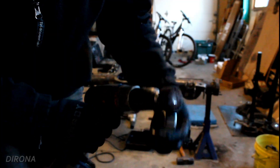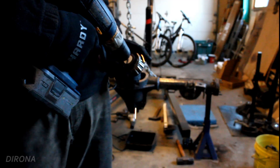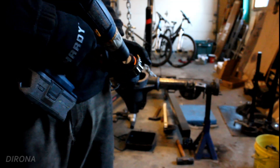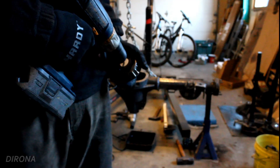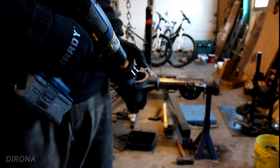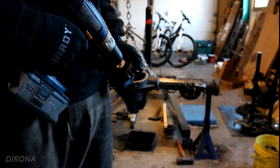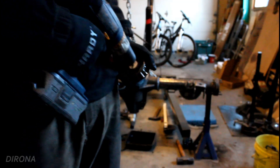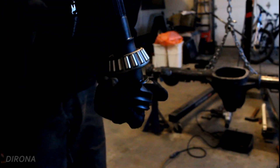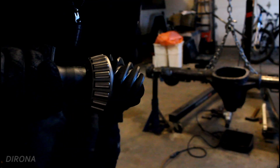I'm just using a little flap wheel on the drill, and we go inside the bearing and widen it out. For anyone who doesn't know, a setup bearing is basically a loose-fitting bearing that we use while we're setting up the gear mesh inside the diff. The reason we make a loose-fitting bearing is because there are shims that need to go behind the bearing, so by having a loose-fitting bearing we're able to take the bearing on and off nice and easily to adjust the shims until we get the right gear mesh. Then, once we get the right gear mesh, we replace the setup bearing with an identical unmodified bearing, and that will get pressed on. There we go — it sits all the way down at the base and we're ready to put some shims in there and get this thing started.